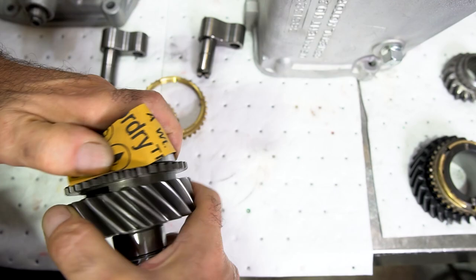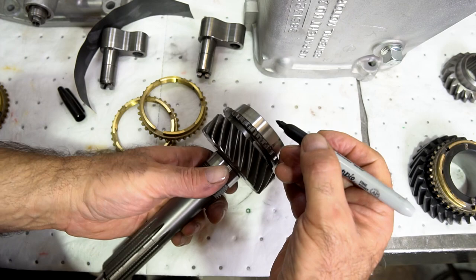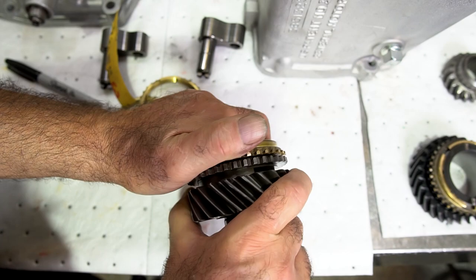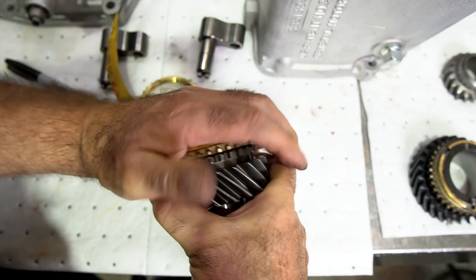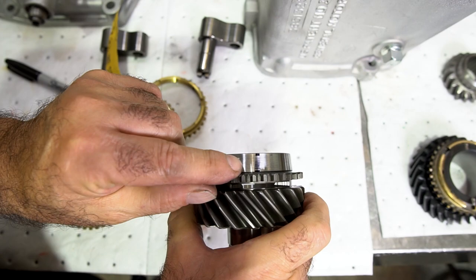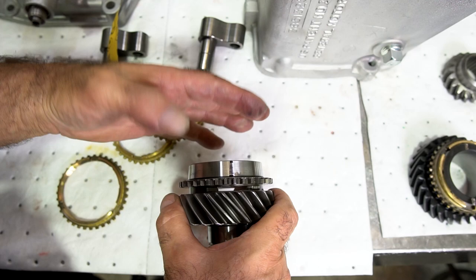Let me mark it again — this is all part of setting up the transmission, not just slapping parts together. Now let's take a good ring, put it on, and push it down with pressure so the ring actually locks on the gear — pushing both ways to squash it together. Look at the contact pattern: it's fully across everything. You can see the distinct oil groove lines of the ring on the whole gear — around every 90 degrees it fits well and is going to work well. The two bad rings are scrapped.